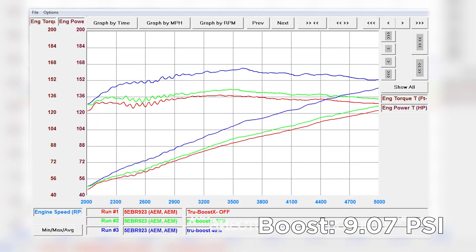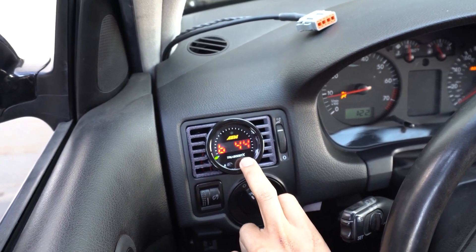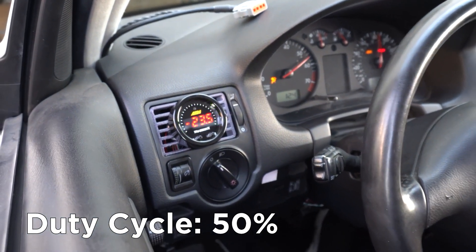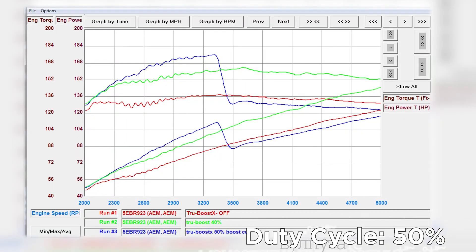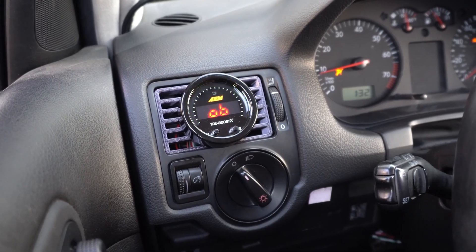Now that we've done our third pass, let's hit our peak recall button. We got 9 pounds, which is pretty close to our target of 10. We'll make a small adjustment to maybe 45–50% duty cycle and that should get us to our 10 psi target, so we'll go ahead and set B to 50% duty cycle. After that pass — it was a little much, we got 12.3 pounds, which is about a pound over the limit. We were a little too aggressive with 50% duty cycle and actually hit the overboost protection. What the gauge does is disable the boost control output and reset back down to wastegate pressure, making sure the engine stays safe.